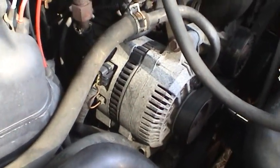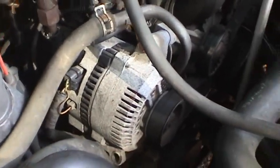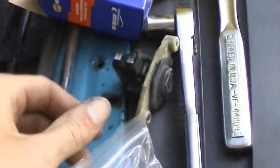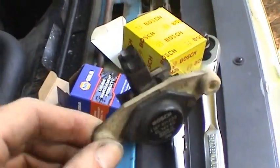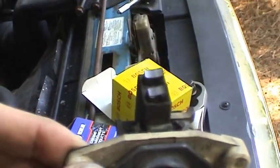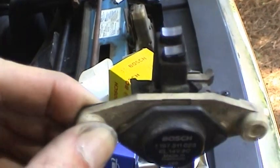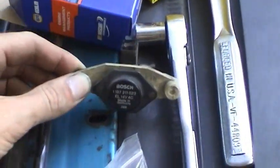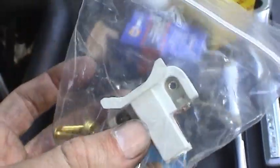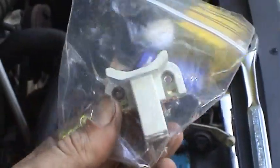I'm going to try to see if I can replace the brushes in this alternator. Just like on the Mercedes and BMWs — the Mercedes 420 SEL — that car has a removable integrated regulator and brush holder, and as you can see the brushes were very worn. That was almost going to leave you on the side of the road. Well, Ford does the same thing with their alternators. You can buy brush kits — you don't even have to get the whole regulator module like a Mercedes. You can just get the brushes for about $9.